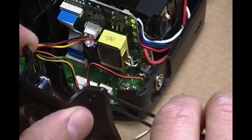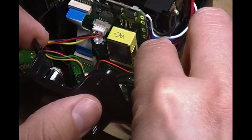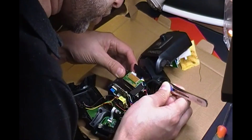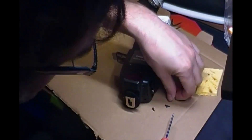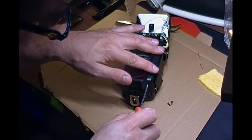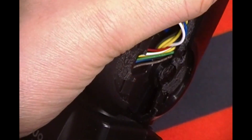Here I am putting the cable back in place. As you can see, it's kind of a pain but it goes back in. I just wanted to point out that at the very top there is a little plastic shield, and you kind of have to finagle it a bit for everything to fit. Here I am just putting everything back together — screws on the very bottom. Be careful when you're tucking in the wires on the side at the top of the flash; you don't want to break or damage any of these wires.